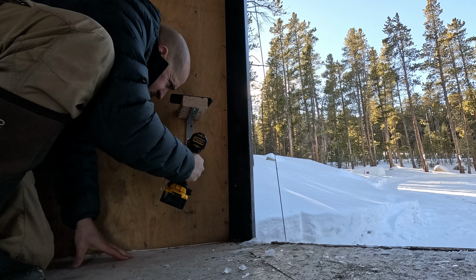I don't know if you can see it with the camera. Take a look outside. Okay, we're at bar 2. Definitely, yeah, more heat coming out now. It's only been a couple minutes, maybe 4 or 5 minutes. And okay, bar 5. Okay, now we got some real heat coming out. A lot of people have said they had a lot of white smoke. I'm wondering if because I adjusted the altitude and the fuel ratio, maybe it's not putting out as much. Maybe it's running much more efficiently. Okay, clicking pretty good. All right, we've got all bars up, it seems like. Yeah, this is getting pretty warm, getting pretty hot, that's for sure.